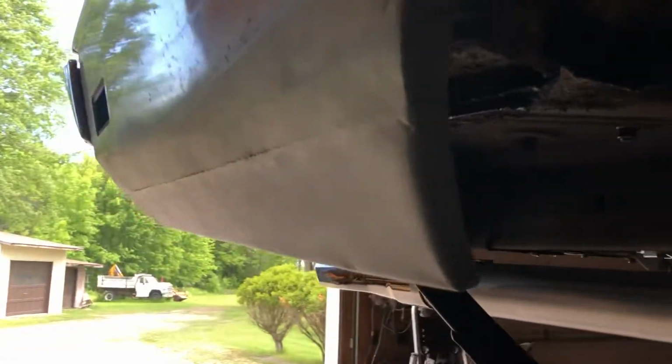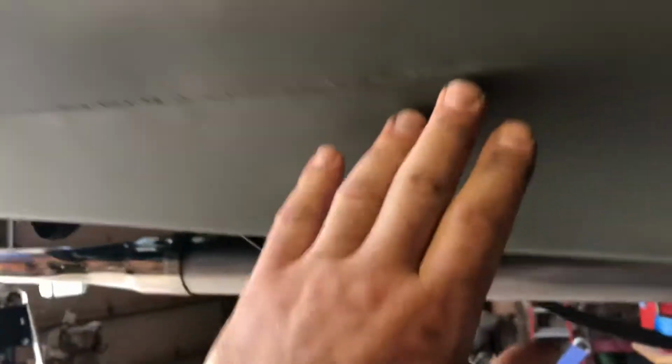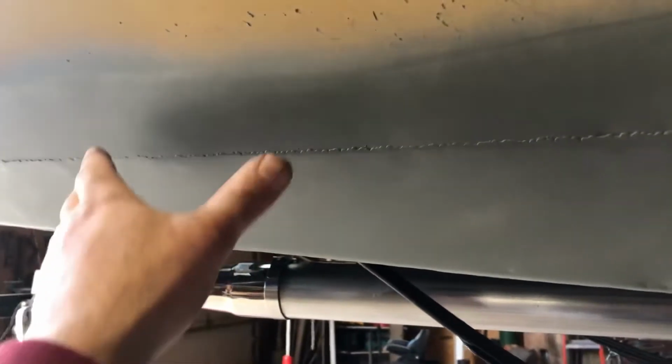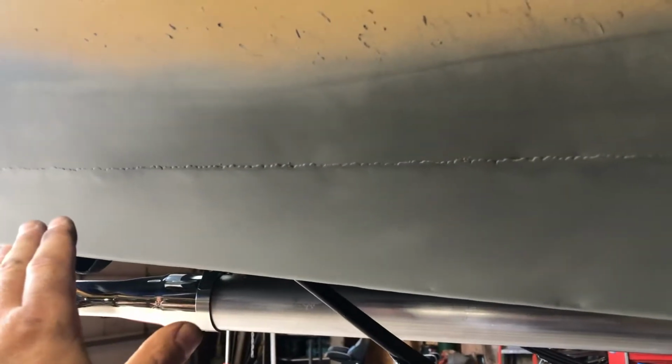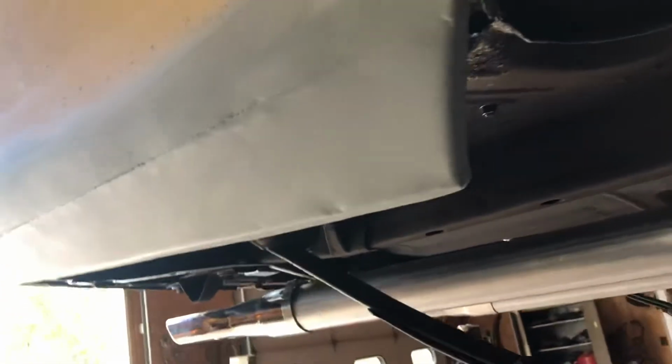We basically made the whole flange and everything with a hammer. The wheel lip molding fits on it perfectly. I cut it off, and then I cut the panel patch, and we fit it in there, and the line fit so well that I adjusted the bottom edge to the flange rather than move it up and try to adjust the cut.